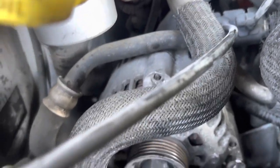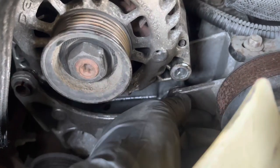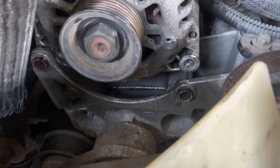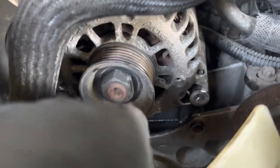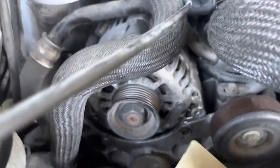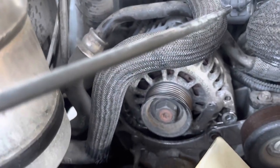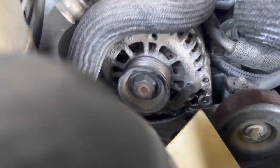All I got to do now is unplug it from the back and then go from there. Put it back in — it's gonna be another pain in the butt because I got to find a way to pull these little spacers back. That way the new alternator would just drop in and I can match the bolts up. So I got it to come down and drop out — it's free. You're gonna get stuck on this side; make sure you have a flathead screwdriver and just keep prying it up and down and it's gonna wiggle its way out.